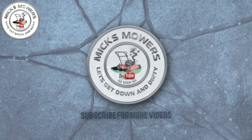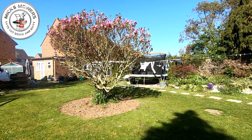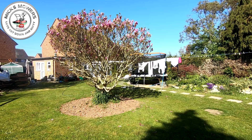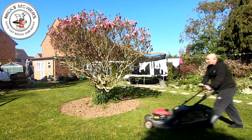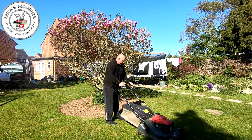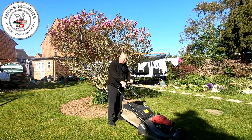Let's get the old machine out. I had to build a ramp going into my shed to save me lifting stuff, which I'm quite pleased with - just a rough thing I knocked up in about half an hour yesterday. It now saves me lifting anything into the shed. Here's the Honda HR-X476 coming to the shop. This is hunting and surging, as the bloke said. Plenty of fuel on it, and you can see it doesn't idle, doesn't pick up, and the pull cord doesn't fully retract all the time.